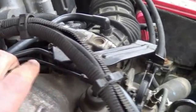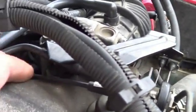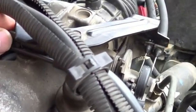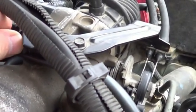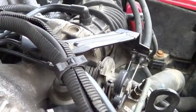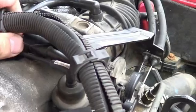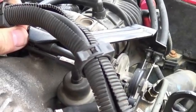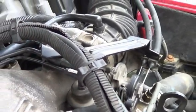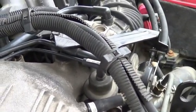It's a bit hard to see in here, but there's a T-fitting here that goes into the upper intake plenum. It's loose around there. As I move that fitting around, it opens up a little gap and lets air sneak in. The engine speed's way up. I'm missing a grommet around that little fitting, so we've got to get that added.